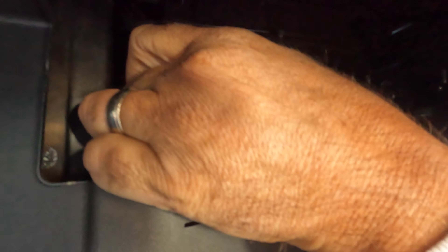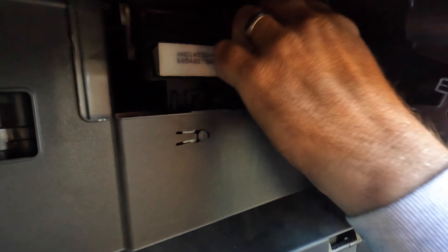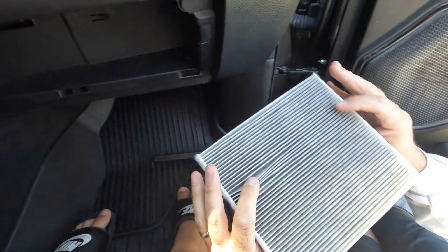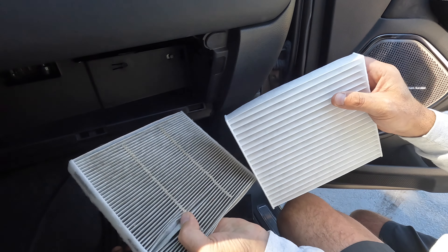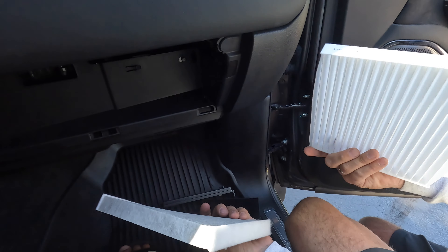The cabin air filter is up here. One thing you do want to pay attention to is the airflow direction. There's a little clip on each side — take both hands and unclip it. If you look on here, airflow goes down. Let's see what this guy looks like. Definitely not horrible, but we'll show you in comparison to the new one. I will say this is a factory one — it definitely seems to have more filtration than this one, certainly more pleats.